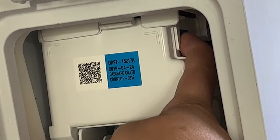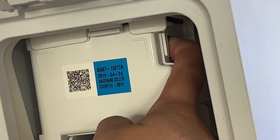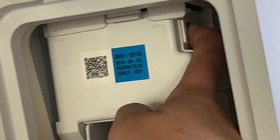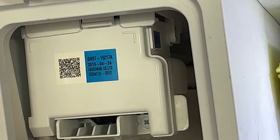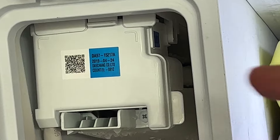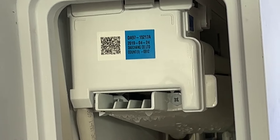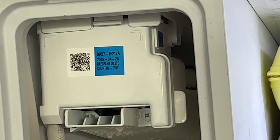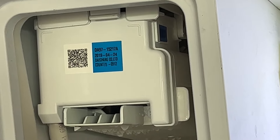You can actually press in on it and then you'll hear a beep. I had to hold it in there a few seconds — and there's the beep. What that does is it turns your ice maker on and off and gets it to reset itself. More than likely, that'll fix it a lot of times.